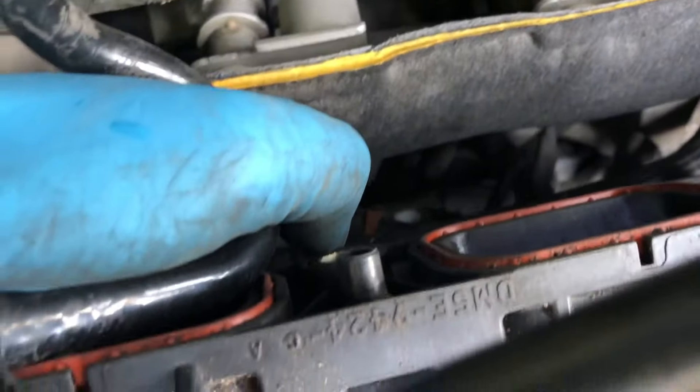The hose coming from your left should be the one connected to the actual intake manifold — if it's not, you did something wrong. I've got it completely seated in. Now to put this in place. It comes with two Phillips head screws. After the install, the only thing you should have left over is the plastic hose that was connected from the manifold to the block, and that's it.